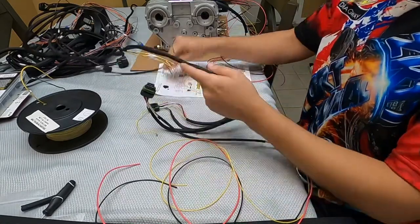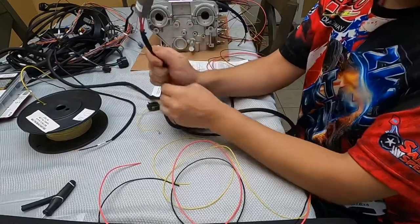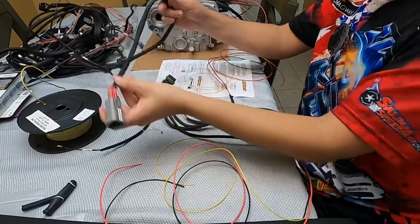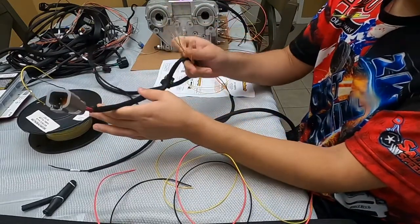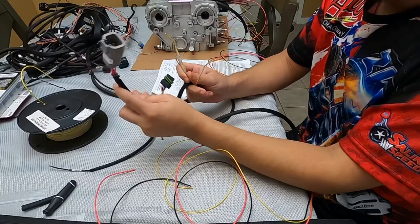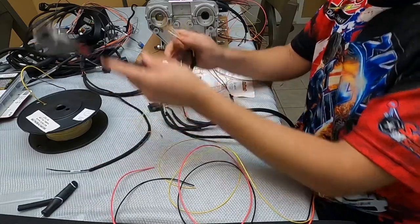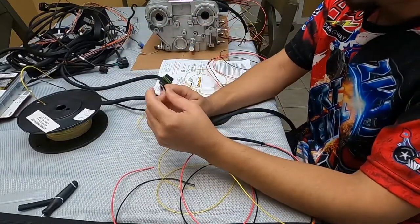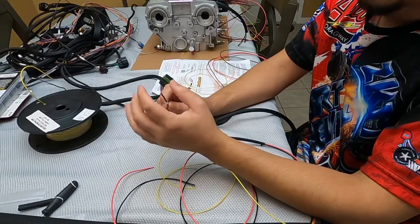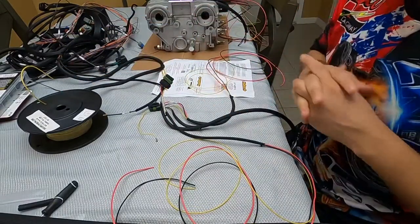This is going to be the main ground wire that comes from the ECU. This plug here — which I actually put into plug form — is the 12-volt ignition power. And then these four wires coming off the side are the signal wires, so the ECU sends a signal to let each coil know to fire. These are also going to be put into a plug — that plug is in the mail right now. This ground wire is also going to be split into four wires and then put into a plug that connects to the coils themselves.